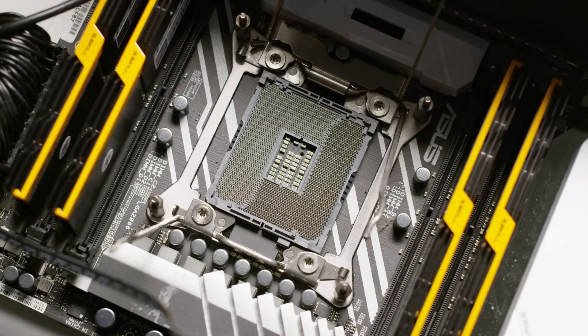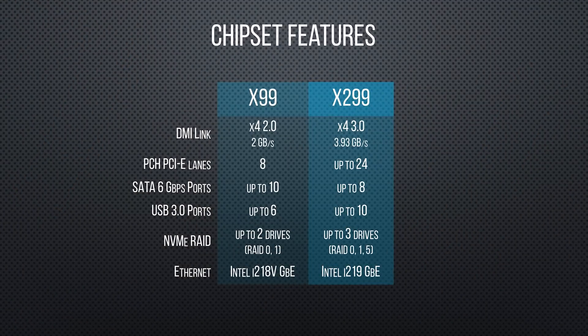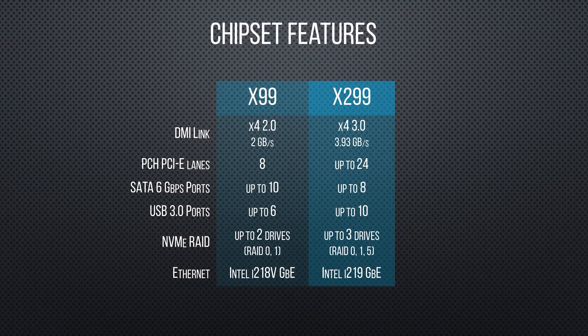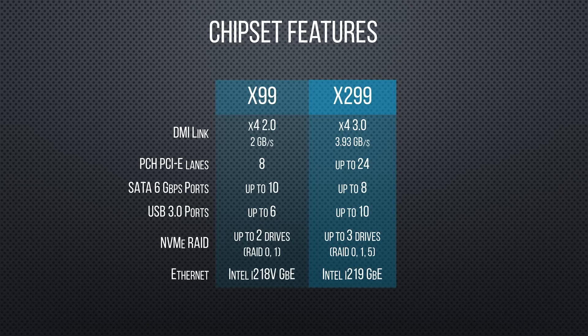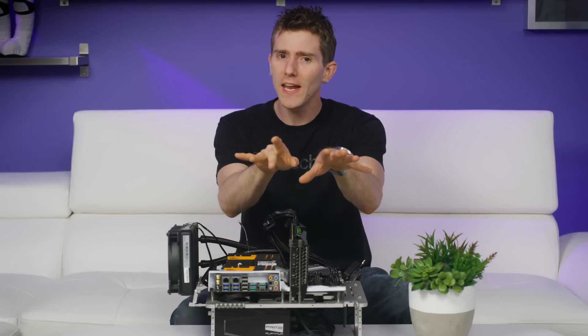X299 then — let's do a short recap for those of you who didn't see our previous video. Intel's brand-new Core i9 chips plug into motherboards with a brand new LGA 2066 socket, connected to a brand new X299 chipset that features more updated I/O, more PCI Express lanes, and a four-lane DMI 3.0 link, plus finer overclocking controls.